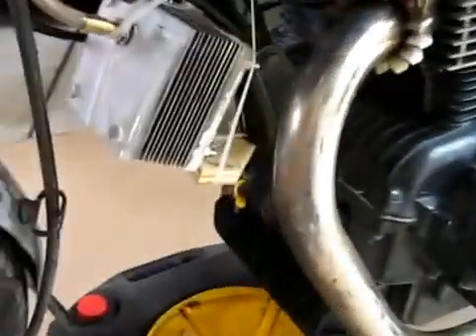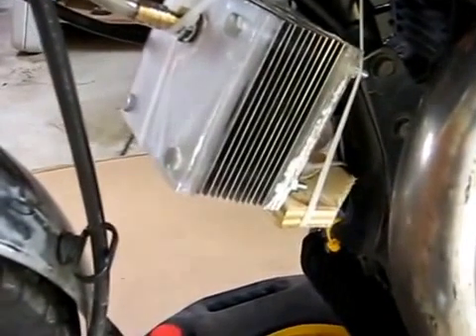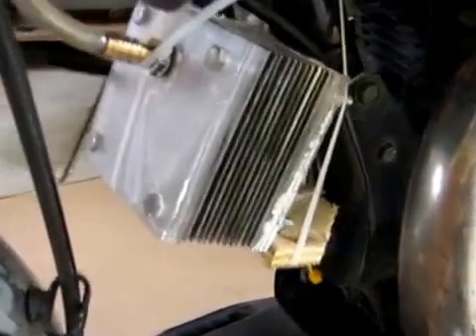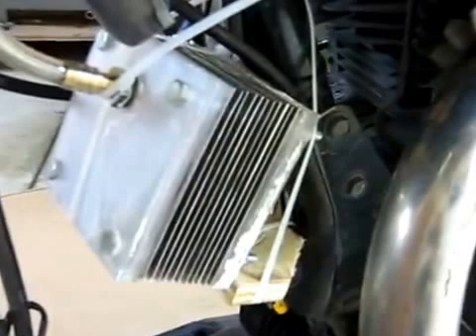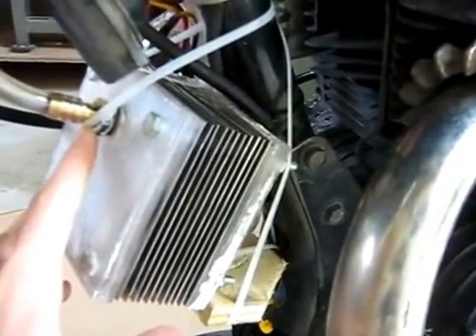So if we look down here, right in front of the engine, you will see the hydrogen generator. There are eight plates of four inch by four inch stainless steel punched with eight holes — four holes for the physical holding of it, then three holes at the bottom, and one hole at the top for the hydrogen export.